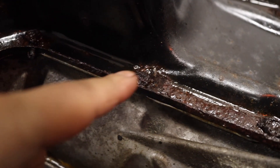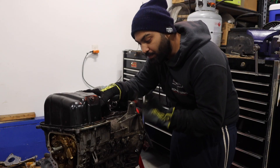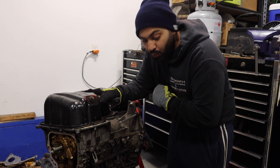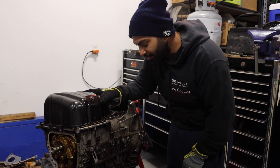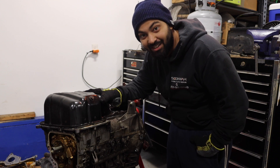So stay tuned. Now I am removing the oil pan from the block. Remember when I told you it was rusted — this is what I'm talking about. Look how ridiculous that is — there's nothing there, it's just gone to bits. I'm carefully trying not to snap any bolts. I sprayed it with some PB Blaster and let it sit for a bit. So far so good, I cracked a few bolts loose and nothing's broken yet. Wish me luck on those other ones that are basically nothing — hopefully I can get them out.